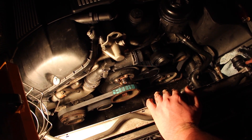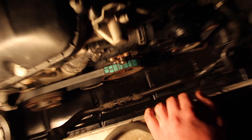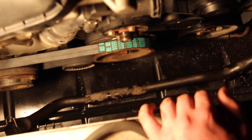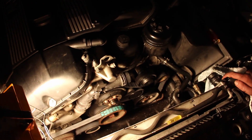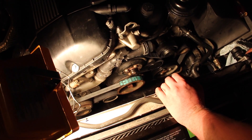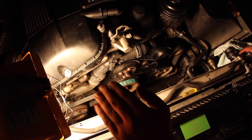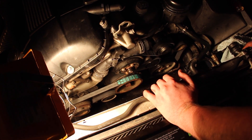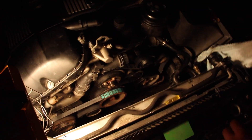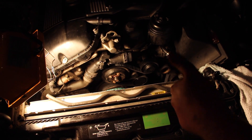We're going to have to add coolant to this car — it's all over the belly pan, as always when working on cooling systems. That will entail bleeding the system: fill up the expansion tank as much as you can, then start the car and turn the heat all the way on. The level will go down — pour more in, then open the bleeder screw. Once that's done, as far as the belts and pulleys go, we're all done.